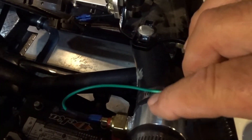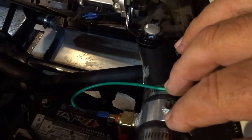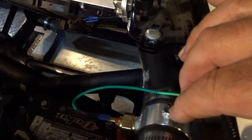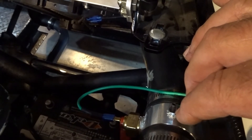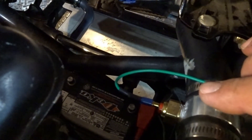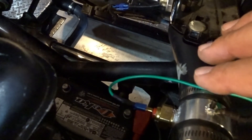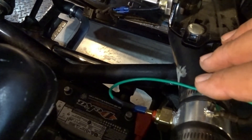This is what it looks like in line. We cut the upper cooling hose going into the radiator and cut out a section to fit our fitting — it's basically a coupling with a sensor bung and a ground terminal stud. I put some Loctite on the stud going into the aluminum to prevent corrosion and keep it from backing out, then added a nut and ring terminal for our ground. I put a female spade connector on the other side for the sensor, keeping it simple and clean. Everything's tightened back up, the coolant is refilled — I had to drain about half a gallon to get the level below the hose while working. It's all back together now.